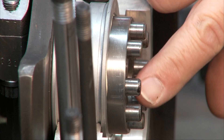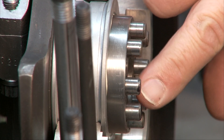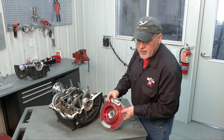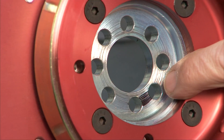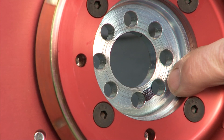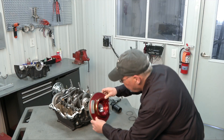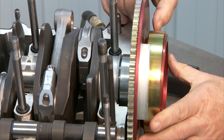I've marked those two pins with black marker so that I can pick them up. In the flywheel I've also marked the two closer holes with a black mark so that I can visually pick that up when I align the flywheel. It makes it real easy to put that on the crankshaft. I'm going to go ahead and slide that on there, sighting right down through the dowel pin holes. It slides right on.